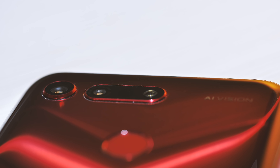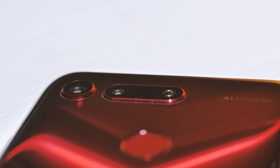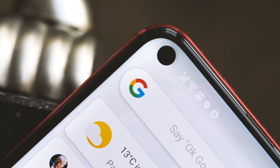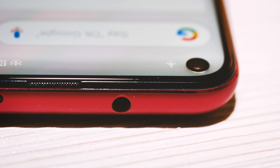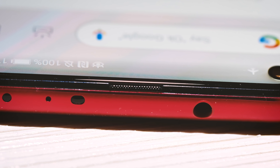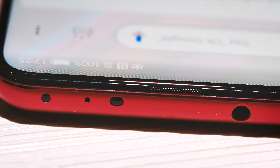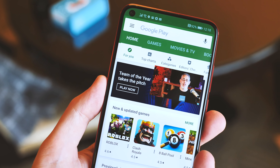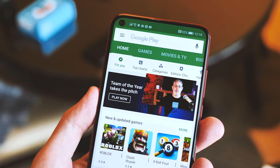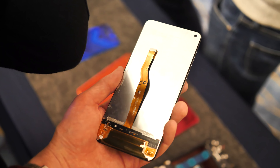You've also got your single 48-megapixel camera module up top, plus Honor's new 3D time-of-flight depth sensor. Around the front is where this phone really looks its most futuristic. We're going to see countless Android phones with hole-punch displays in 2019, but Honor is the first to bring this design to the West. So there's no notch — the speaker grille lives in the border between the screen and the metal frame, the ambient light sensor has been moved to the top bezel, and the camera appears through a 4.5mm hole in the screen. A lot of unique engineering work has gone into getting all this to work right with an LCD panel, and the technology is quite different from what Samsung is doing with its OLED-based hole-punch displays.